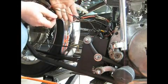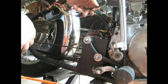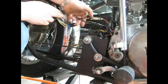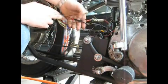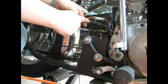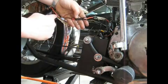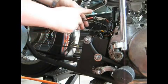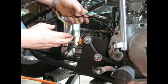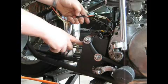A tricky part is the brown wire, which comes from the regulator rectifier and goes into what comes from your stator rotor assembly. In my instance that wire is black, so it's brown to black. In between the brown-to-black connection, you also need to feed it juice — meaning when the key switch is off, no juice is fed to that connection, and when the key switch is on, juice is fed to it.